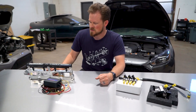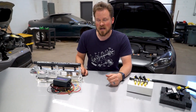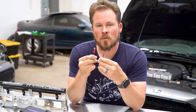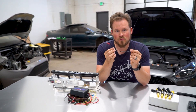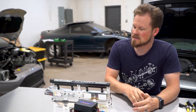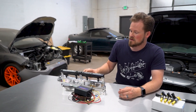The price point pro goes to the Aux Fuel kit. Now the cons for Aux Fuel are the complexity of install and the potential reliability issues down the road. These little clips and connections will work right out of the gate and for some time, but it's kind of a gremlin waiting to happen — if it fails or gets corroded, you're going to have problems and you won't know until your internals become your externals and it's too late. If you have an electrical gremlin from tapping into your factory wiring harness, you won't know it until it's too late and you could cause serious damage to your engine.